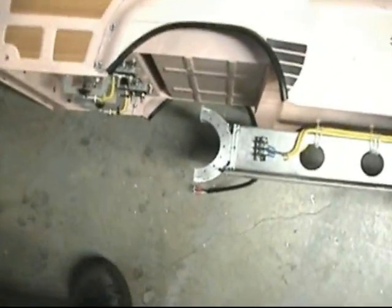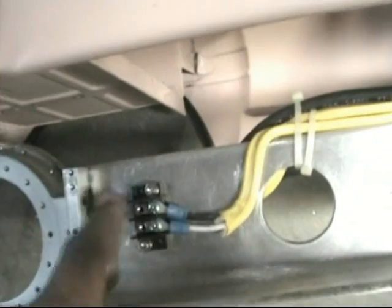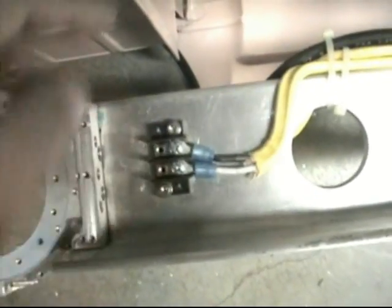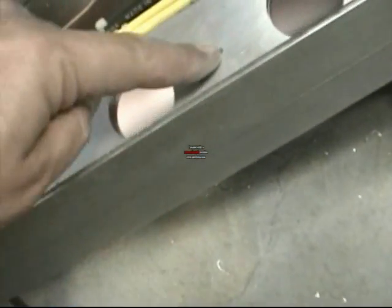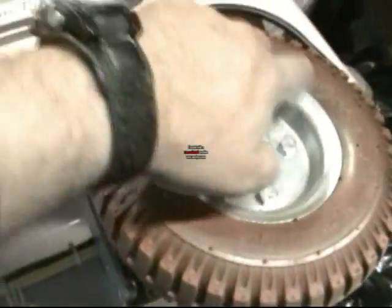In the back here, that's where the rear axle essentially sits inside. This is the other half of the cooling housing, and right there you can see the holes where the power comes through — essentially from here through there. Then it connects to the motor, so when everything gets pushed down inside here, they poke out right here and you make your connections on either side. This is just a piece of angle aluminum — you can see there's two of them screwed together. I have the cable directly attached via the top right here.